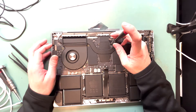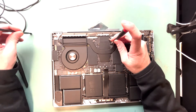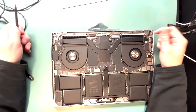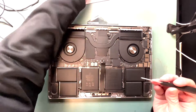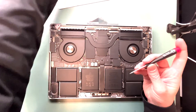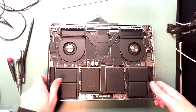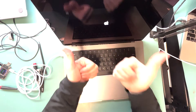I'm really happy about this MacBook's design — the MagSafe charger that disconnects when someone trips on it instead of pulling the whole MacBook off the table is the best design for a charge port. For the last stage, connect the battery back on, put the trackpad cover back on with a T3 screwdriver, connect the main connector, then flip it over, plug it in, and give it a final test. Make sure the Wi-Fi is working too, since it's easy to forget to reconnect things. Worth it.